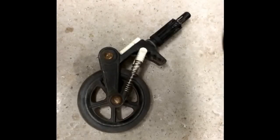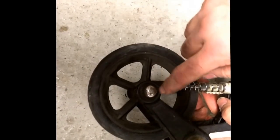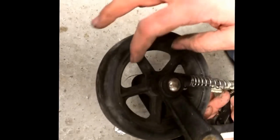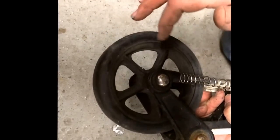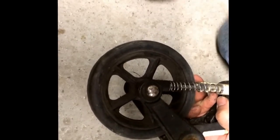Another sort of ball bearing axle problem would be like this wheel. As you see, while I turn the wheel, the center plug turns as well, and this means that the ball bearings have rusted fast onto the axle and are holding it in place. I can try to oil it, but on occasion if the ball bearing has been too damaged by rust it will eventually crack open, lose its balls and be more or less like the other one.